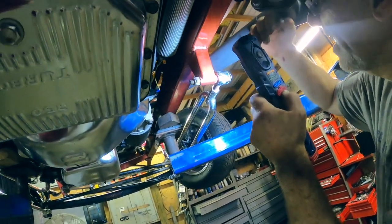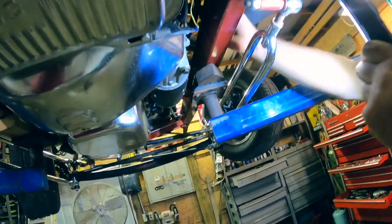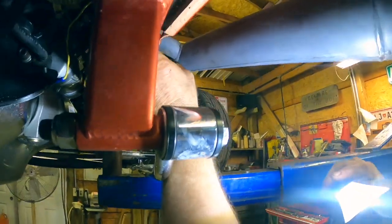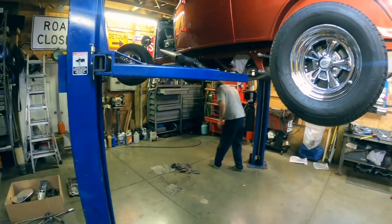Here we did the wiring underneath — existing holes where they ran the fuel line. We ran the power for the fuel pump up through an existing hole, and that worked out pretty well. Here's the oxygen sensor — it's got to be at a 38-degree downward angle. I thought about doing it over here, but we're going to mount it right here, plug down, connector coming right here under the body. The sensor will come up and sneak under — you won't even see it. That's about it — about four days' work, ladies and gents.